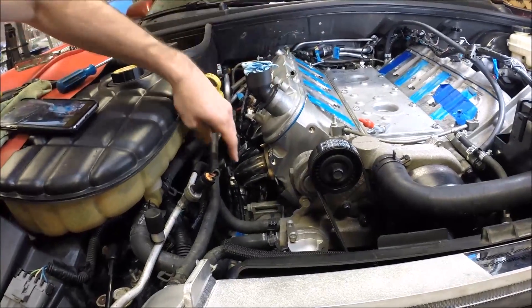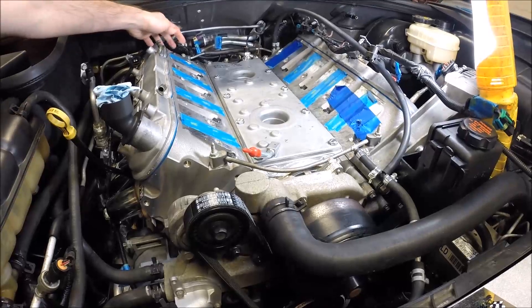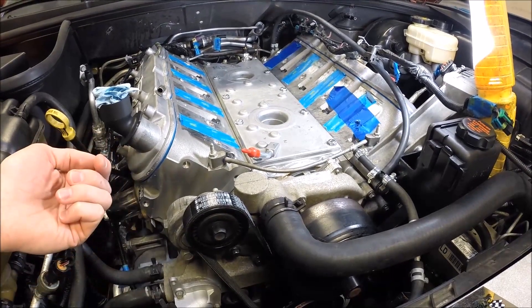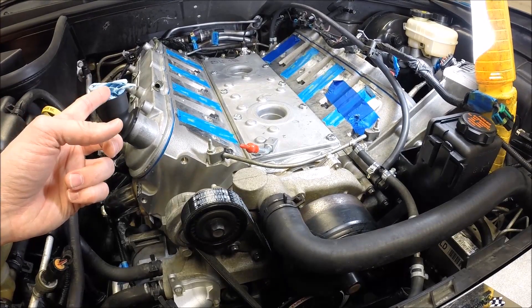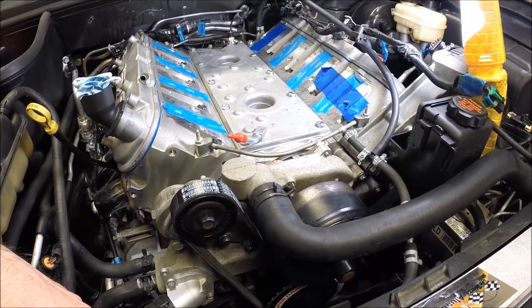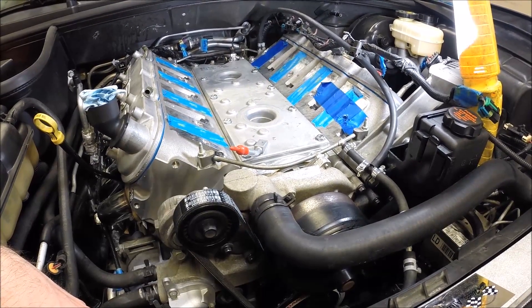If I ever have a leak or if I don't like how this system works, that might be something I consider. I hope that gives you at least a few ideas about how you could set up your steam vent lines. Give some thought to opening up those rear ports — depending on what cylinder heads you have, you either have little block-offs without the line, or you may have plugs that are pressed into the cylinder heads that you have to knock out from the inside, which is how these were. When I had the heads off — if you look at the first cylinder head installation video — you can see how I punched out the rear plugs for the back steam vent ports. Anyway, I hope this helps. If you got any questions hit me up in the comments, and as always please like and subscribe — it helps my videos and helps me keep making new videos for you guys. Take care and we'll see you next time.